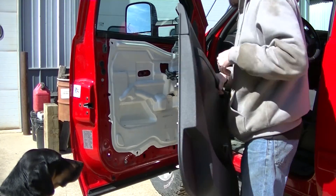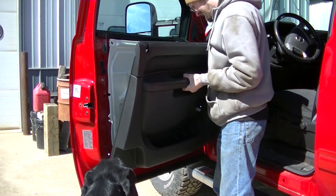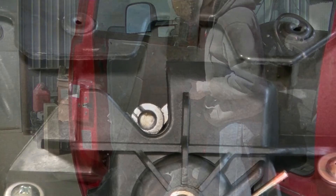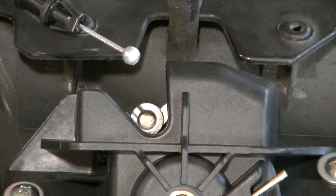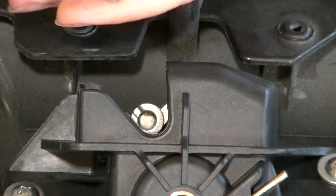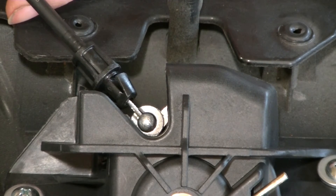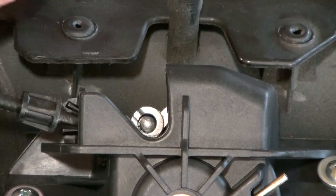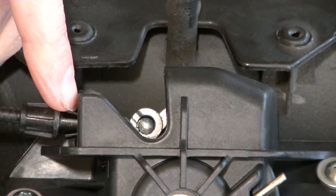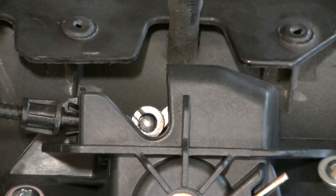The first thing I've got to do is hook up my door handle — get that cable ball into the deal. I'm not going to be able to show you how to put the cable back on with the door panel in the way. So I'll show you right here: the ball end goes into the deal like that, you pull it outward, rotate it in like that, and push it into the hole on the side. That's how you install this cable back onto the handle.